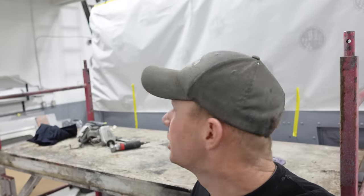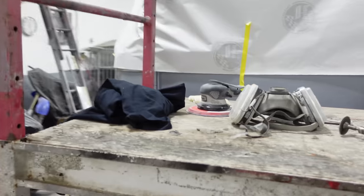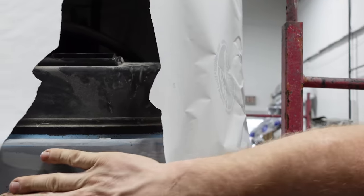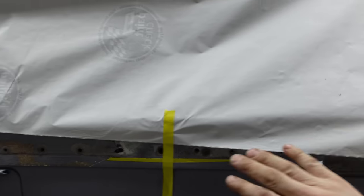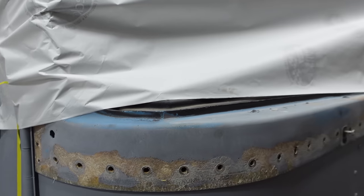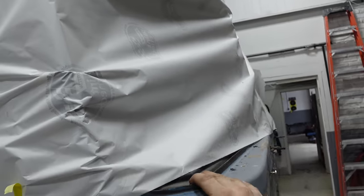All right, so that's it from Newport. We're gonna wait for that to dry. They're gonna buzz that down, and then probably put a spray putty on there, and then blend that into the sides, and then paint that. Got a little bit to fix on the fiberglass on the front here yet. We shaved that down. They pulled all the rivets out, and then we'll put a little skim coat over that, and then a couple cracks in the fiberglass around for the rubber, so we're gonna fix that at the same time. So yeah, back at the shop, we'll carry on with the engine.